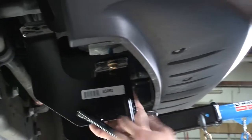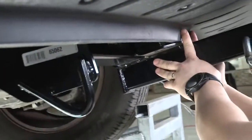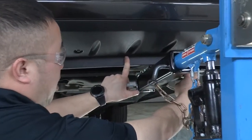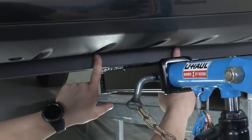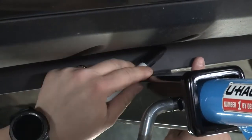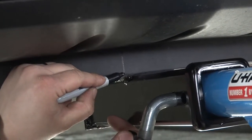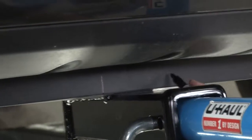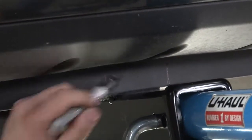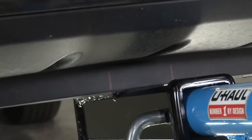Now that we have just the two bolts holding it in place so it does not slide back and forth, you can see how much we'll need to trim on the front bumper to get the hitch to go up into position. The instructions call for eight inches of trimming, but for this particular vehicle we don't need that much. We're going to be trimming just the width of the receiver tube and then doing an inch and a half up to this bottom lip here — that's the only piece that will be taken off. We'll make a straight up-and-down line here, one on the opposite side as well, and then right across the top. Then you can pull your hitch down out of the way and start your trimming.